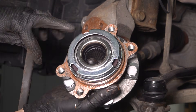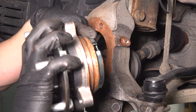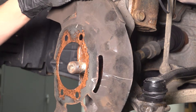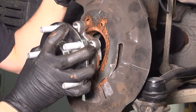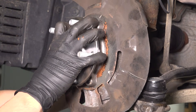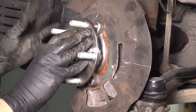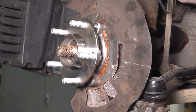On the back of the wheel bearing, you'll notice three cutouts for the ABS sensor. When you put it on, make sure that one of the cutouts faces towards the ABS hole. Don't forget to put on your backing shield. Give this a couple twists to line it up with the axle and clamp it all together. Now that it's on, don't let it go for too long because it's not bolted on yet.